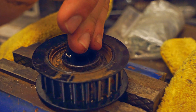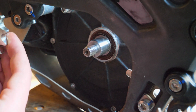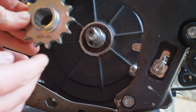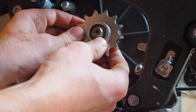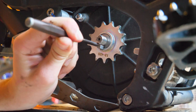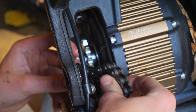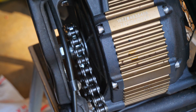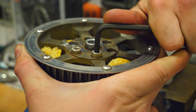Next you want to hit out the key that is inside of the old pulley because you're going to need that to put the new one on. Once you have the key out from the old pinion you're going to want to bust open the conversion kit and pull out your new pinion gear for the chain. Slide it over the motor shaft, and after that you're going to want to tap the key in — it should go in pretty easily, just use a punch and tap it in with a hammer. At this point I would recommend feeding your chain in from behind so you don't forget it, and wrap it around the pinion gear.